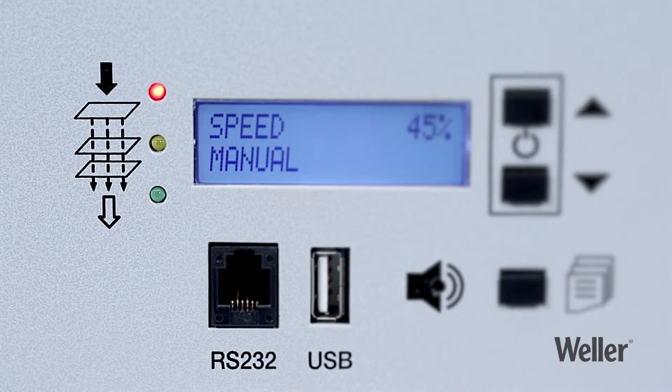Red — a clear warning signal sounds. You must replace the filter as soon as possible. The traffic light system tells you how much dirt has accumulated in both the pre-filter and the compact filter.